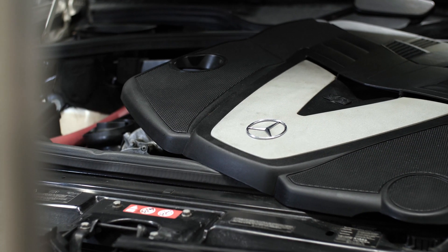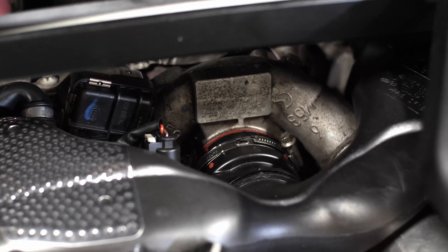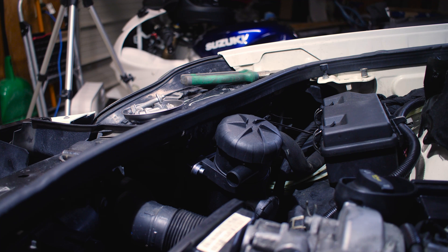We've got to address the main issue here and this is oil blow-by. Basically Mercedes plumbed the crankcase ventilation hose directly next to the turbocharger. The turbo spools up and literally sucks oil from the crankcase steady through the turbocharger, through the intercooler, through the plumbing, back into the turbo — and the air intakes are getting really dirty, caked in with oily residue. Along with EGR, that's also an issue, but we can definitely help solve the blow-by issue.